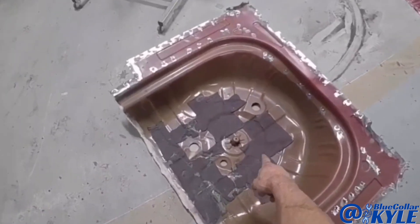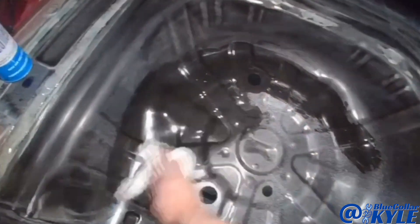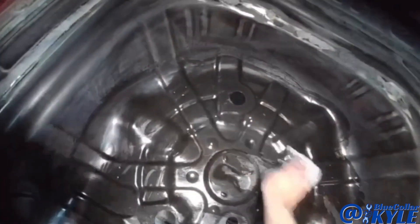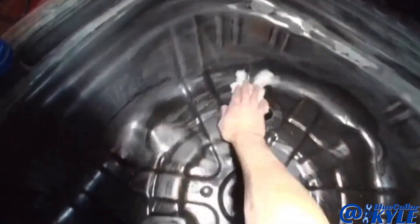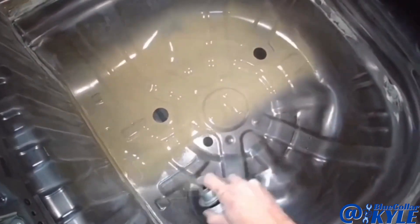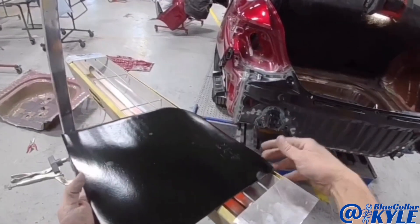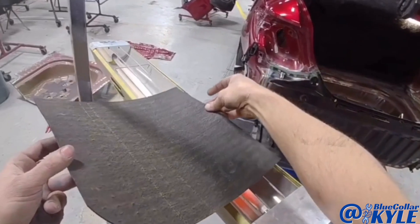You can see here this old floor has sound deadening pads that go on the bottom center of it. So I'm going to go ahead and clean off this new trunk floor and put some paint down in this bottom section so I can lay out the sound deadening pads and get that part finished up — then whenever our paint department paints this trunk floor they can spray right over all of it. These are just some generic sound deadening pads; I use this heat lamp to warm them up, make them more pliable, and it also makes them stick a lot better.